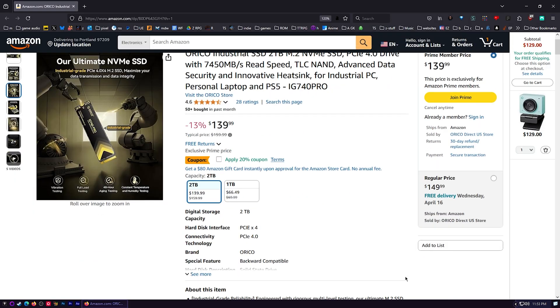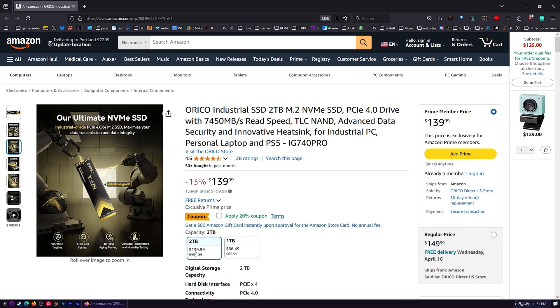When you think about what's reasonable when 7400 MB/s is the max and it was running at 7400 throughout all the tests, the bottom line is: it's fast and it has a lot of industry-grade features. It's not going to allow you to write a gazillion times like an industrial SLC-based drive would, but for most home users you're going to get something that's a lot faster and can run hotter without getting into trouble. The MTBF — how long you can leave it running — is 1.5 million hours.